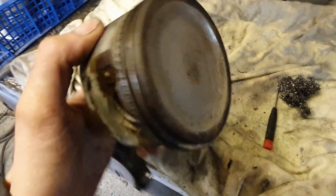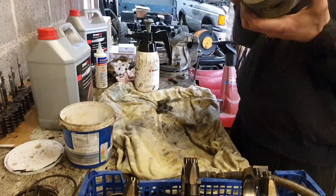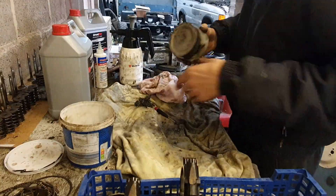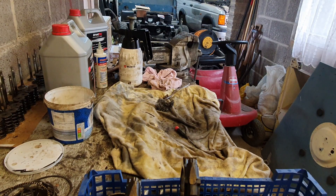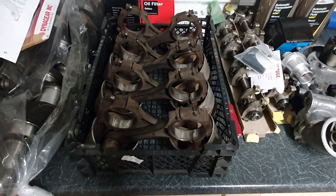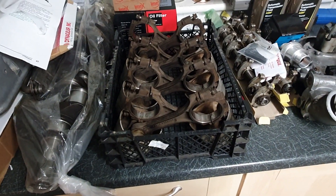I'm using a little screwdriver to very gently scrape the dirt out of the piston ring land. But as you'll see, I wasn't happy with how it went so I'm going to do it all again. When every piston was complete I sprayed it off with brake cleaner and made sure it was spotlessly clean before moving on to the next. So that's the pistons all done — it took a while. I wasn't happy with the piston ring grooves, they weren't clean enough, so I did them all again, scraped a little more material out, and I'm glad I did. They're all ready to go now.